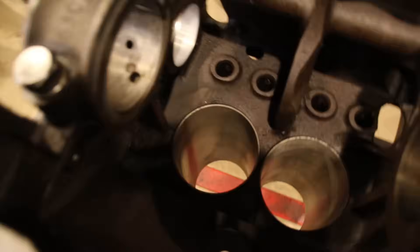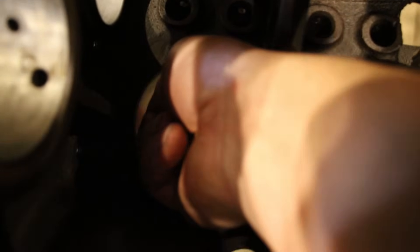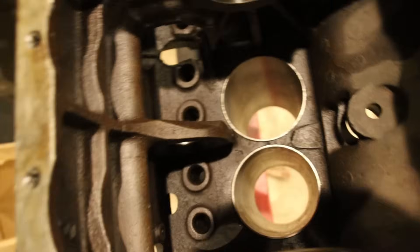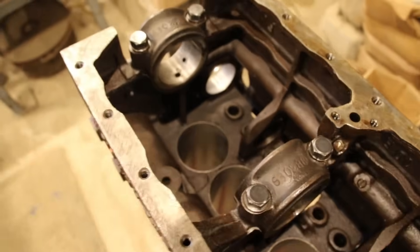On the number one sleeve, do you see that line in there? You hear that sound? That's my fingernail catching on that sleeve. It's actually not one sleeve - there's a sleeve and then there's a tiny part of a sleeve put down under the first sleeve. It measures maybe two inches on that sleeve. See how tiny that piece of sleeve is? I do have reservations about that. I don't feel good about that.